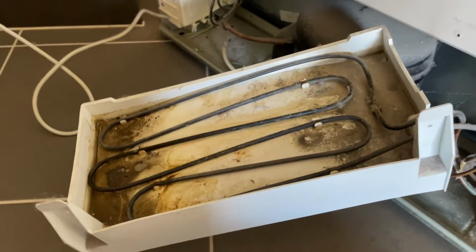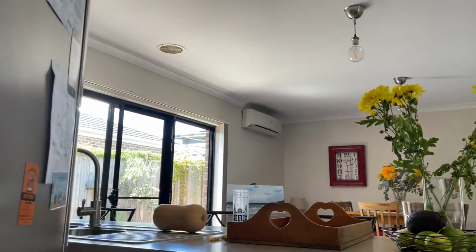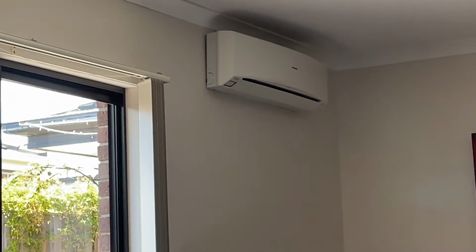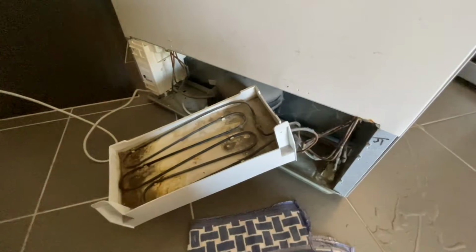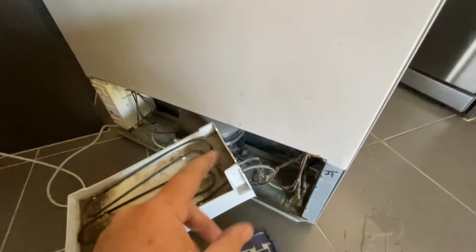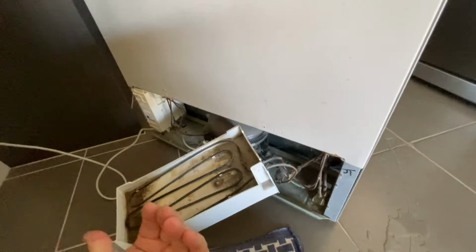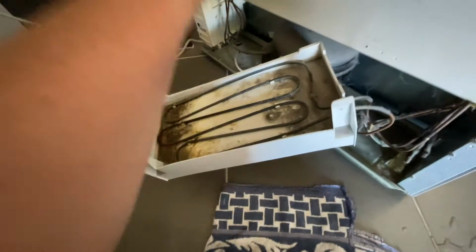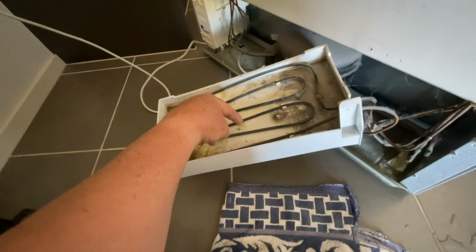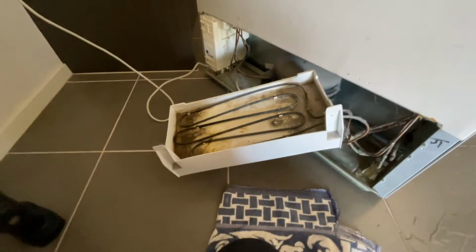How this works: these refrigeration systems, be it an air conditioner, like there's an air conditioner up there, when it's blowing cold inside the house, the system that's outside is blowing hot. And it's the same thing with the fridge. When the compressor and so forth is doing the same thing, it's making the fridge cold. There's a hot side of that always. It's a heat pump. It transfers the heat. And part of that, they're putting this heat into this coil so that when that water we're talking about comes in here, it heats, so it evaporates and goes back into the system so the tank doesn't overfill.